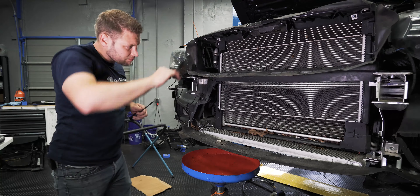You can now remove this piece of trim and the one on the other side. Lift it up, pull it out, and then under the light here push this out of the way so that you can pry up here — this whole piece will come out. This is the piece you're prying up on, so be very careful, these are very fragile. Once you've done this side, do the same on the other. For this shroud, you can either remove it or leave it on — we're going to leave it on as it doesn't really get in the way.